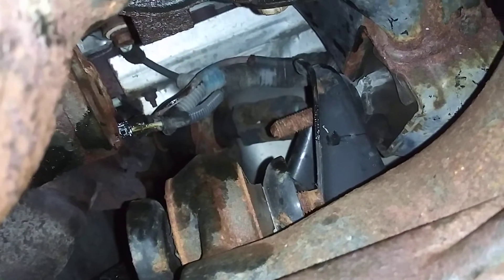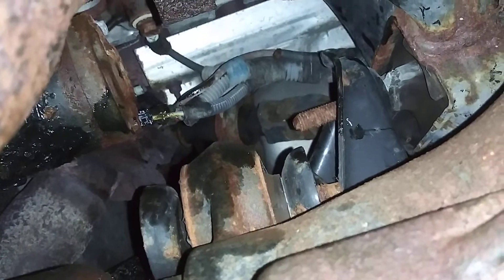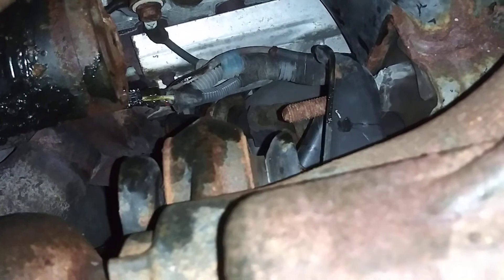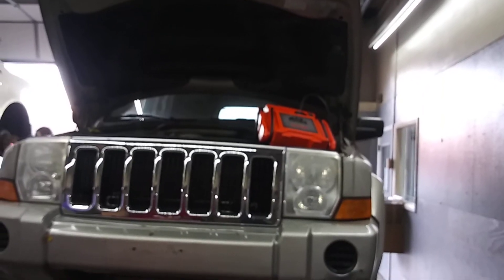So basically, what's probably going on with this vehicle is there's a bad connection on the signal wire to the starter. We're going to clean that up and see what happens. Now we've hooked our signal wire back up to our starter — a little dielectric grease, cleaned it up. We know we have 12 volts on the yellow wire when we're in start position, and we jumped off the starter with the battery. Voltage is going to the starter — it should fire up. Let's let the car down and see what happens.